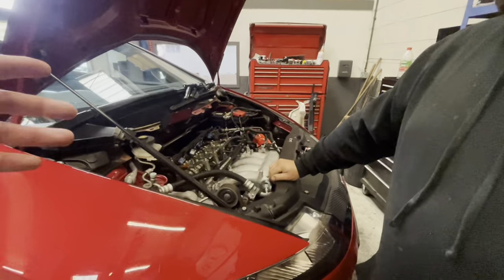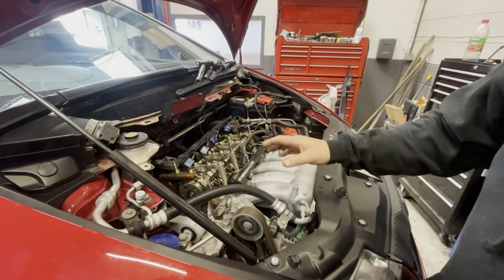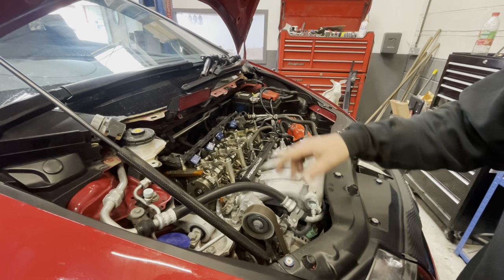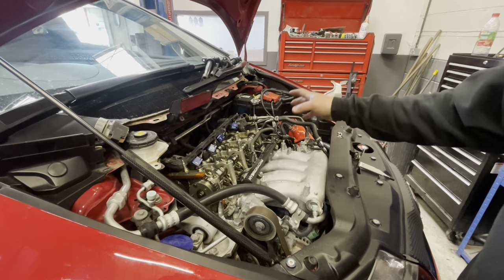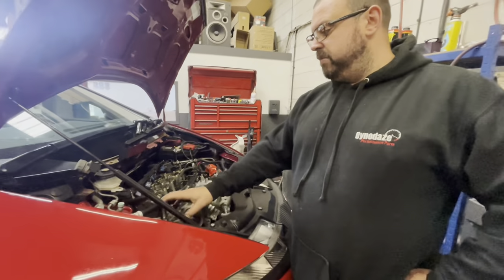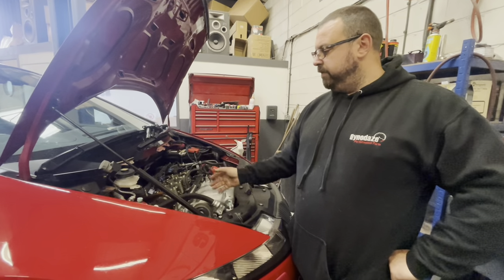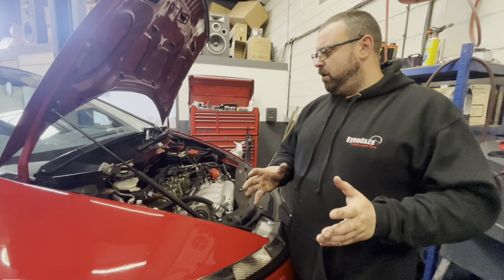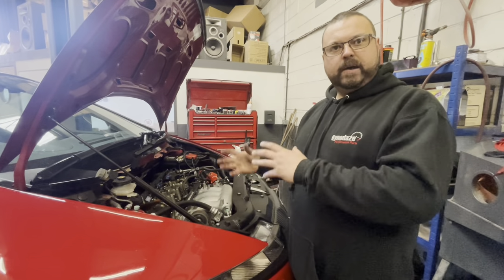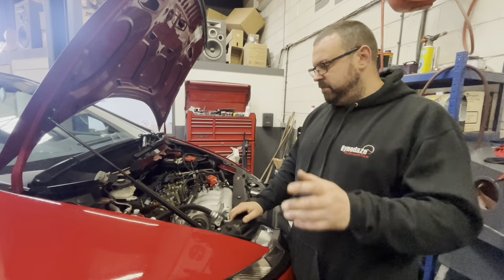So what is the process? Pretty much you've got to take stuff off to gain access. At the minute Jensen's took the under tray off, drained the oil out, took the scuttle panel off, and removed the rocker cover — basic things to start off with. We're going to have to remove the engine mounts, the side engine casing, and obviously the sump's going to come off. I think what we'll probably do is go through that as we do each section, so once we've got it stripped we'll go through what to look out for and how to time it back up.